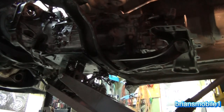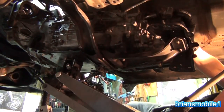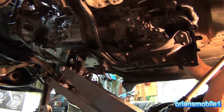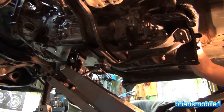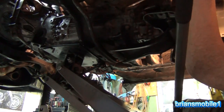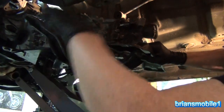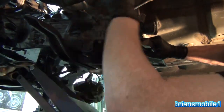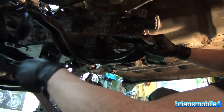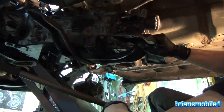A lot of transmissions in cars I'll just pick them up and put them in — on a lot of trucks I'll do the same thing. Super ones are a little bit long and heavy, but this is the way to do it: use a transmission jack. When you have a transmission jack you can control the angle, take your time, you're not under stress. You do a good job — at the back end you've got those long studs on the engine, and it's nice to be able to get those just right. Take your foam pad or whatever and support the engine so it's tipped back a little bit.